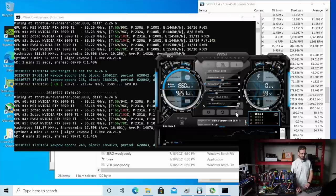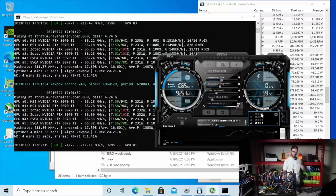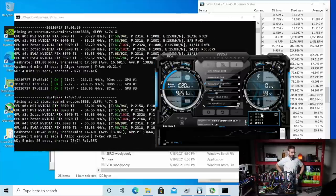We're going to go down to 70. We're just striving to find a little bit of efficiency here. Then we'll see what we can make up once we start messing with the overclocks and pushing that core clock and memory clock a little bit. I'm going to do the first four and leave those EVGAs as our benchmark for 35 mega hash at 230 watts. Hopefully get the memory temperatures down a little bit. Those Zotacs seem to be running the hottest. This EVGA is running really cool.